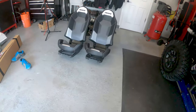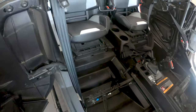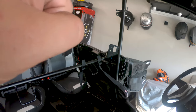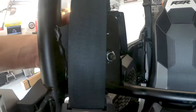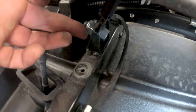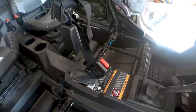This is a custom kit — very generic. Seats are removed obviously; you know how to do that if you're going to tackle this, you just pop them out and pull them. I've got one of them installed here, and again this is more of an explanation video. The seat belt has been unhooked over there. On this side, I started right here, unbolted this, dropped it down, unbolted this, dropped it down, and then unbolted this — so it's just three sets. Then you're going to need to unbolt this, get into here, and unbolt that. I ran my strap through there just like that.